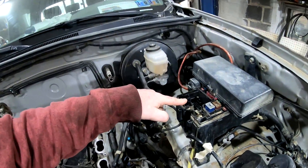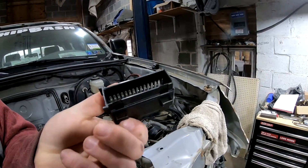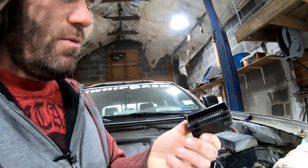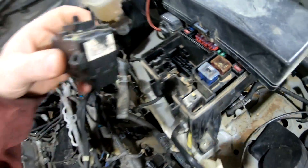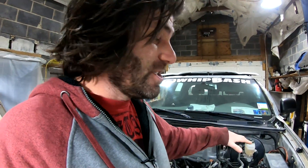Right now I'm about to run down to the shop - that's where my old swap is still sitting. I haven't got rid of it yet; I'm not trying to get rid of anything until I see this thing run and know everything's right. I'm going to have to map out those plugs and might have to dig this open and figure out where all these wires go. Unfortunately it's not going to be easy because I popped this out - I thought maybe it was some kind of control box, but once I pulled it out I look and it's just like a transformer. It must be like a junction connector within a plug - it's like an adapter. So you plug in there and then this plugs into this. I've never seen anything quite like that. That's not going to make it easy to figure out where these wires go, so I might have to just plug that in and start checking for continuity to fuses and stuff like that.